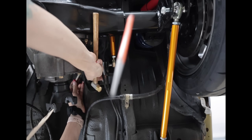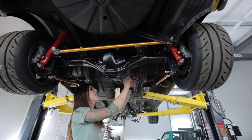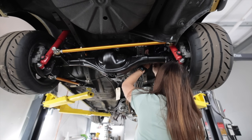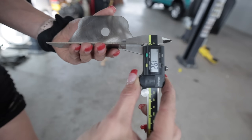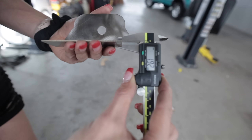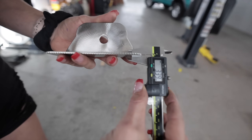It was at this point I realized I messed up — that is a punch sitting on top of a $2,200 camera lens. Thankfully, it missed. For comparison, on camera they might look like the same thickness, but this is twice the weight. The test piece was 1.92mm thick; the final version is 3.39mm thick. Since these ones are not getting welded — they're a bolt-on part — they're made out of stainless. The front ones are getting welded in place, so those are made out of mild steel.